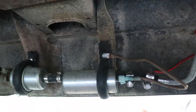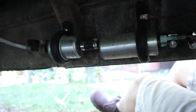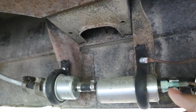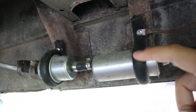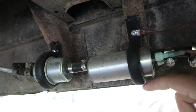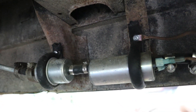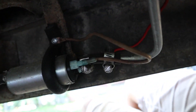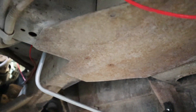This is the fuel pump I have. It's a Carter unit and it came with a fuel filter attached, which I think is a good idea. The way I mount them — which is very easy using readily available materials — is just to use fuel line as a rubber isolator. You can wrap it around, drill some holes, screw it in, and mount one of your grounds there. Then you need one wire going up to your relay. We'll go into that more in the electronics section in a bit.